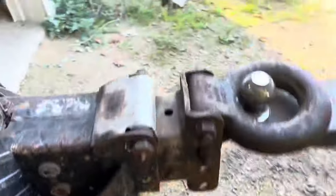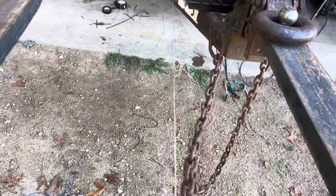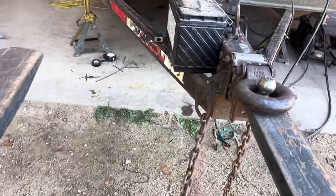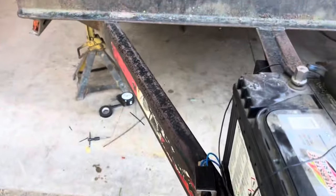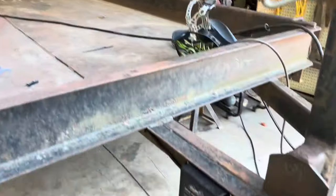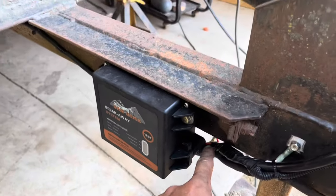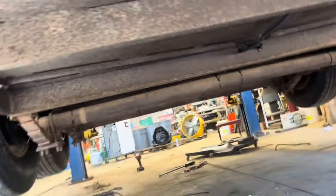This cable is set perfectly so that when the safety chain tightens up against the truck, the breakaway pin pops out. The cable should never be looser than the chain. The blue wire from the bottom pin of the seven-pin goes directly into the brakes — all I have it doing is going to a red wire that travels all the way along the center of the trailer. The wires coming out of the brakes don't matter if it's positive or negative — it's an electromagnet, so as long as one wire is grounded and one is 12-volt, you're going to be just fine.